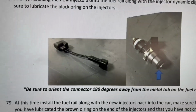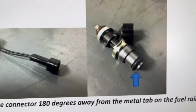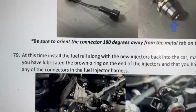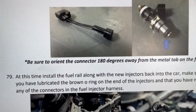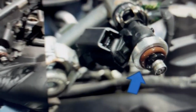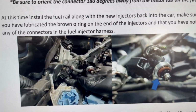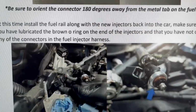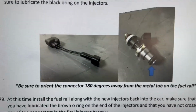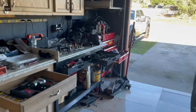and followed by again making sure that grommet from the previous injectors don't fall inside. And now I'm going to proceed to install the harnesses on the injectors, and also it tells you to lubricate the grommet before you put them in, so they can slide right in, and the new grommets won't break by pressuring it in without the lubrication. So here we are.